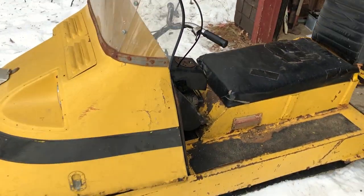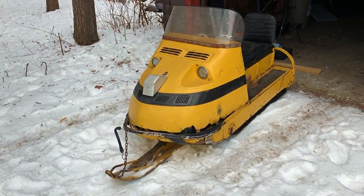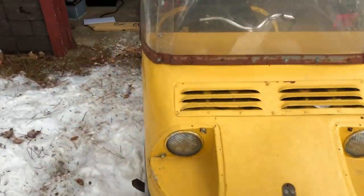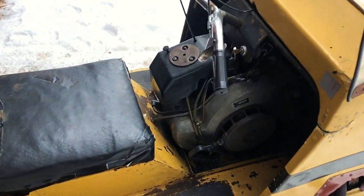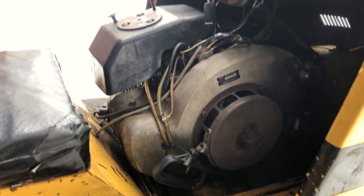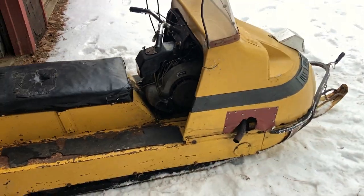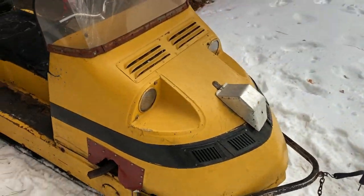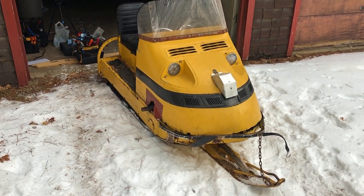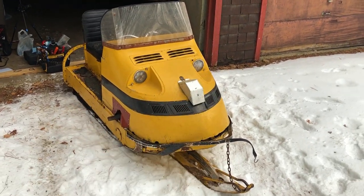And like I said, 1968 Super Alpine. Big difference between a regular Alpine was, like I said, the 370 Rotax twin cylinder engine. Now, Bombardier in '67 produced these engines for the first time. It would have been the first production twin cylinder engine. They had them in a couple Olympics, a couple being about 125 of them, and the Super Alpines. This is the '68, a lot less rare than the '67s, but the big difference between any other Alpine model is it had the dual headlights.